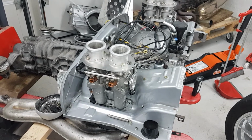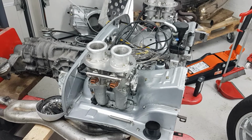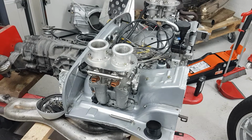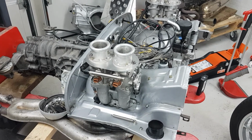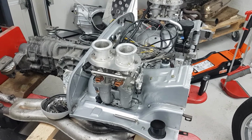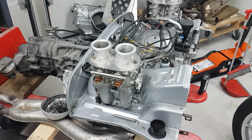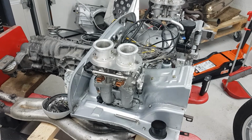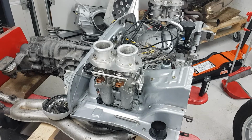It's got the 914 2.0 cylinders bored for 96mm. It's got Keith Black pistons, chrome push rods. The heads were the stock 1.7 heads that are welded up and machined for 2.0 configuration. It's got 44mm inlet valves and 38mm exhaust valves, and the head was ported and the valves unshrouded.